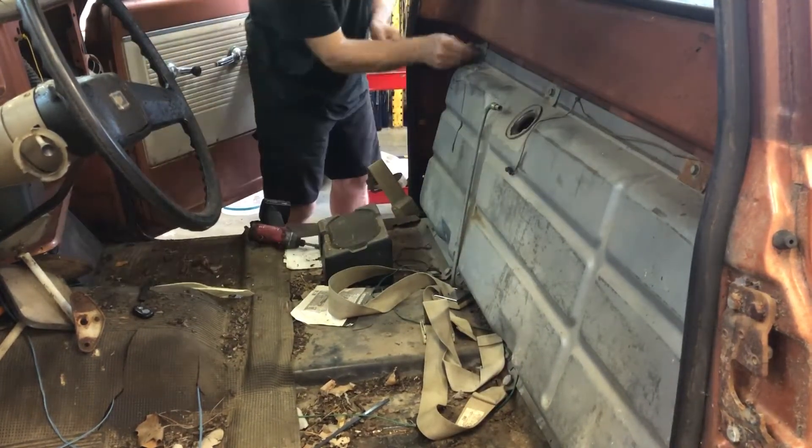So far it kind of looks like the other one, so that's good news. Let's set it and go over by it and see. It's about the same size and everything. I'm just looking at the holes to see if they're in the right location. The filler neck's about the same angle. The sending unit hole is in about the right spot. Those holes are in the same neighborhood, so I think we're okay. There's a slight ding in the corner — I'm going to straighten that out, but I think we're okay to go ahead and try to put it in.